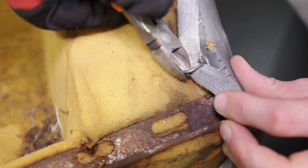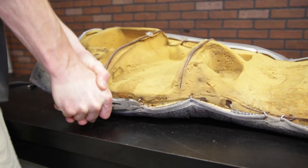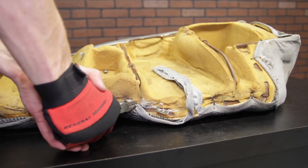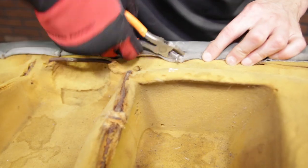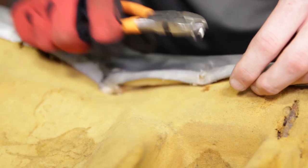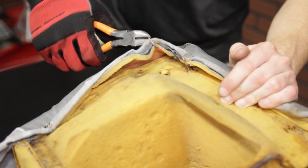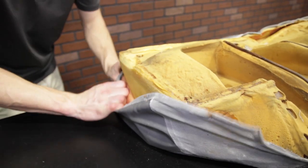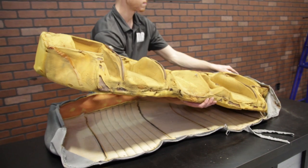I'll be picking up with both the seat bottom and seat backs out of the car. Starting on the seat bottom, begin by working your way around the entire underside of the seat pulling or cutting the hog rings. I found it easiest to carefully pry them open and then remove them from the foam with a pair of cutters. If you plan on keeping the upholstery that is on the foam, be mindful when pulling the hog ring so you don't rip the fabric. Once all the hog rings have been removed, separate the old upholstery from the seat bottom foam.